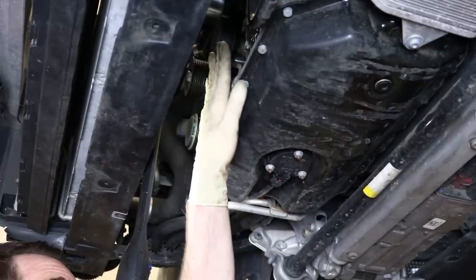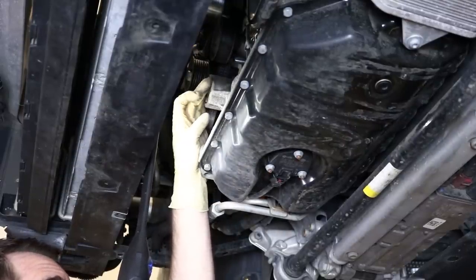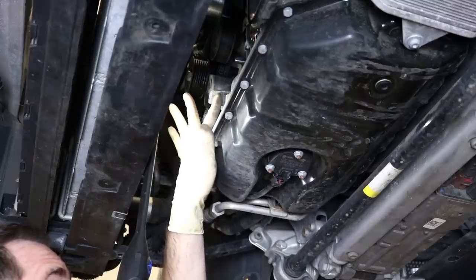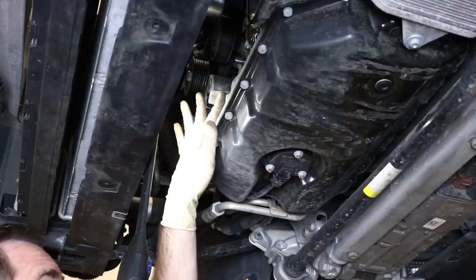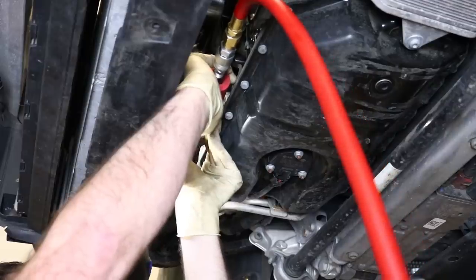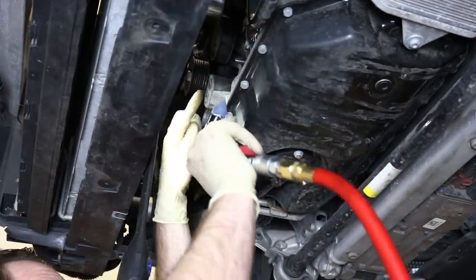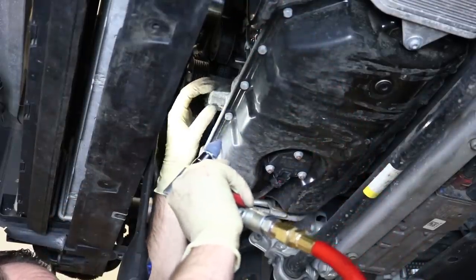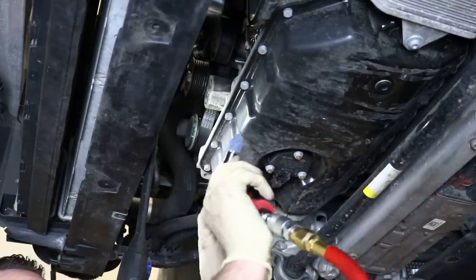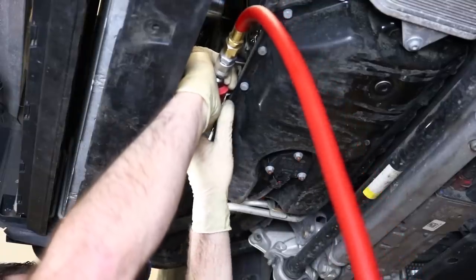Before we install our new pulley, because the new pulley is wider you have clearance issues around the notch. What you need to do is take about three millimeters out of this piece in that direction. We're going to grind it down — you can use a cutoff wheel or grinder. At home you might also try to file it down. Now that we've finished grinding, we're ready to install our pulley.